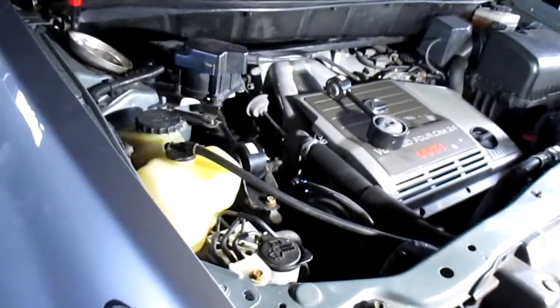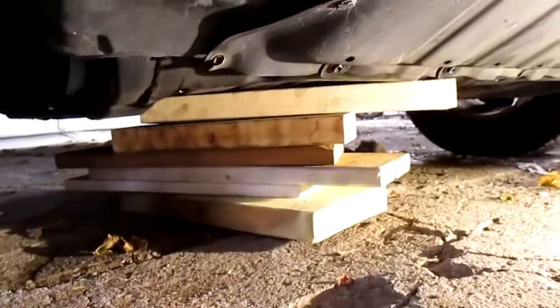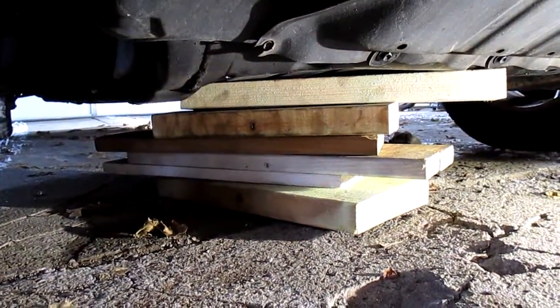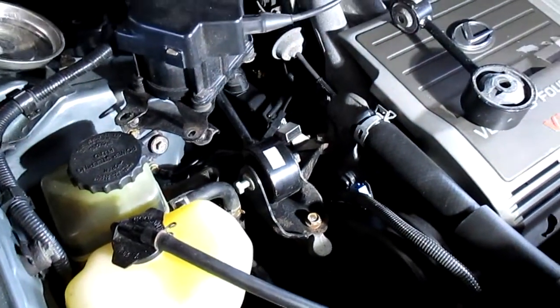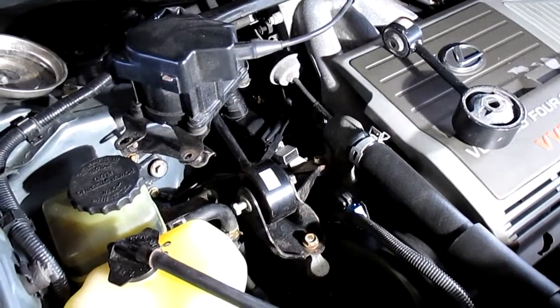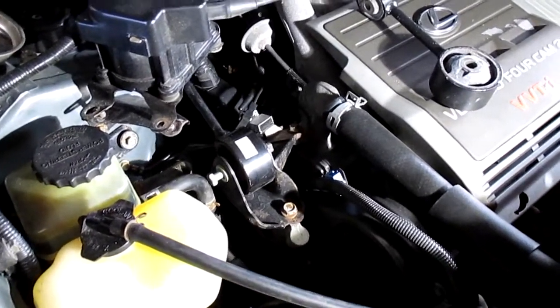Since this is part of the engine mount system, I went ahead and braced underneath the oil pan, just with some boards, because the engine is probably going to drop a little bit when you take those bolts out and it might be hard to get lined back up. If you're going to use a jack, make sure the contact surface is flat — if not, use a board under there so you don't damage the oil pan.